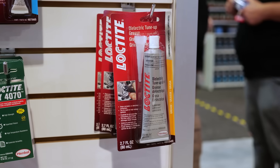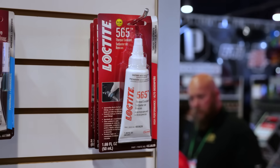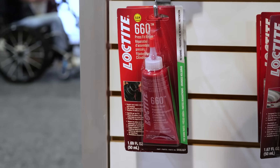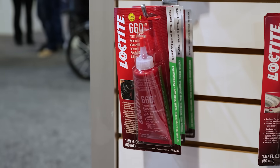You should really use anti-seize on there — it eliminates corrosion and galling inside the threads, which helps keep a stronger hold on that nut or bolt. An anti-seize on anything seeing heat is going to save you a lifetime of frustration when it comes to removing those fasteners. Nothing worse than threads picking up and galling, destroying the stud or threaded hole.